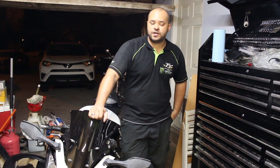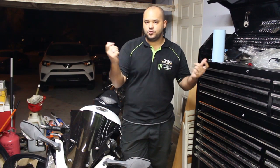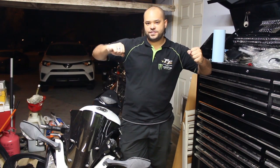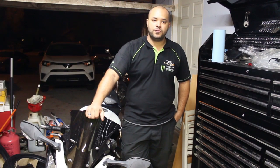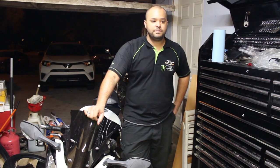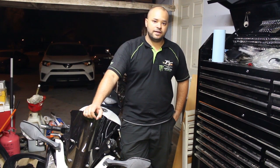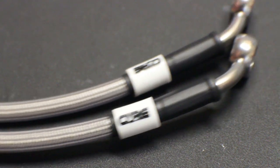Every bike is going to be a little bit different as far as master cylinder placement and line routing setups. The steel braided brake lines I used in this video are from a company called Core Moto, and they specialize in making steel braided lines. The cool thing about them is if the angle of the banjo fittings don't line up perfectly, you can put two plastic pens through each end and twist — they actually rotate and it doesn't void the warranty. They're still just as strong as from the factory. You can also customize the colors completely. I'm not paid for this and they're not sponsoring the video. Galfer is another good company, but Core Moto gives you the most customizable options from colors of the logo, the lines, and the fittings. I was able to get natural steel with a white logo and silver ends, which I thought went with my bike pretty well.